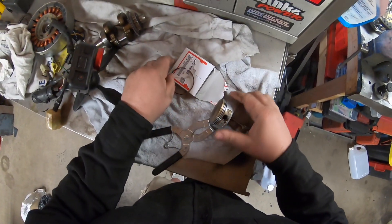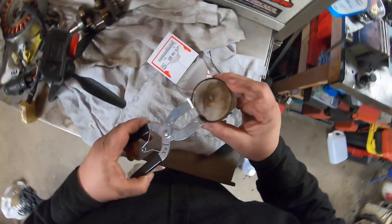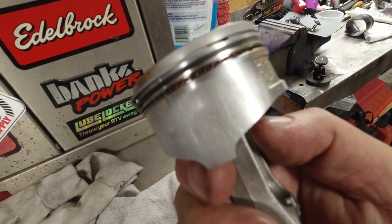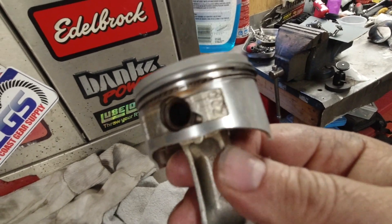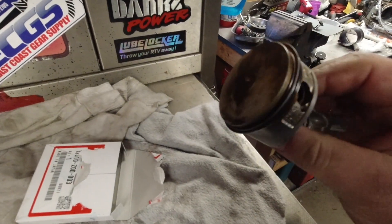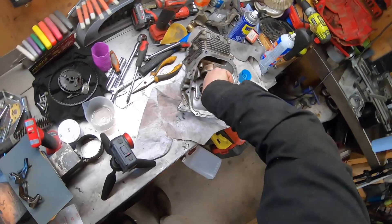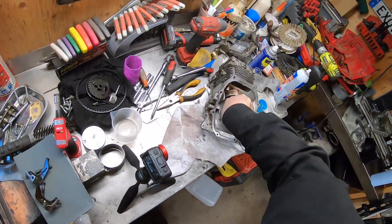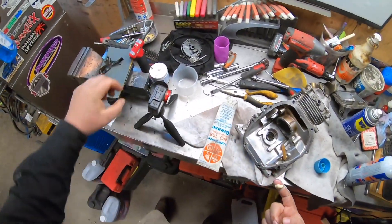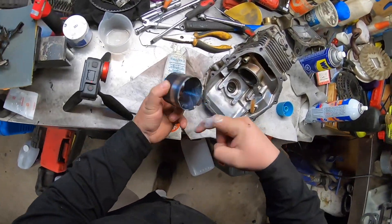That's a tight fit. We'll worry about the placement of the piston rings afterwards because they've got to be 120 degrees apart. The piston ring gap: top ring is right there, second one — everything's kind of split. We don't want to move that around too much. For the piston assembly, we're going to totally coat the cylinder with assembly grease, and we're also going to take the piston assembly tool and coat that — not the piston itself.